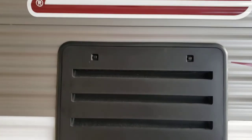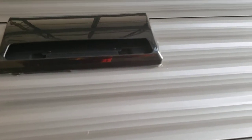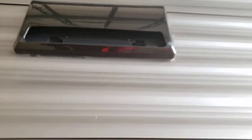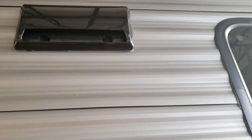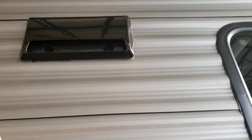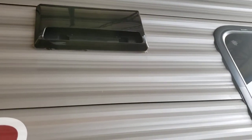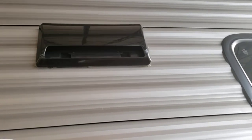Intake for your fridge — your exhaust is on the roof, that's just for airflow. Keep those little grates clean; you can even pop this whole panel off and clean it. Right over there you have your exterior vent for your range hood. You just pop this tab out — that'll allow whatever you're venting to actually escape. If not, your fan vent's not really doing anything. Snap it closed before you travel, and I recommend closing it overnight so you don't get any insects in there.